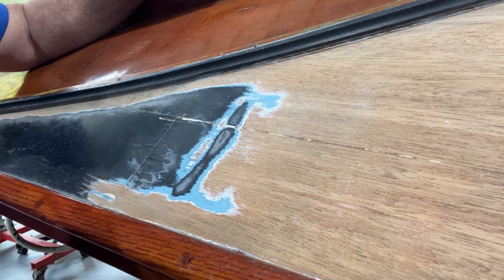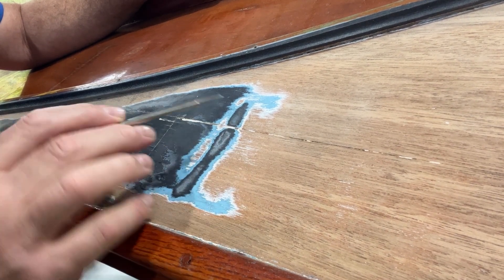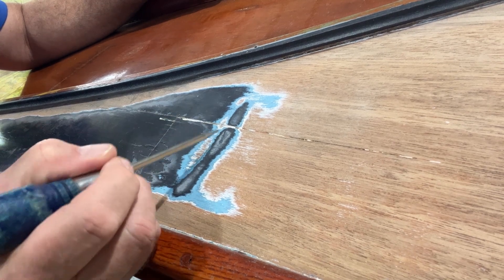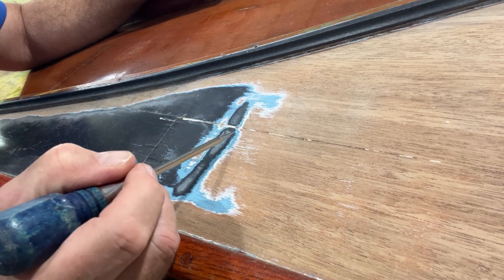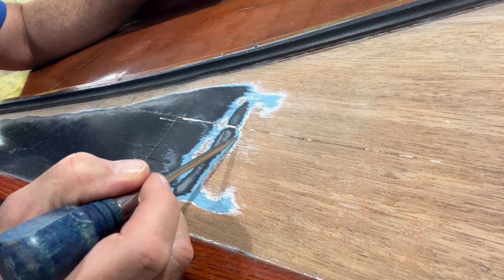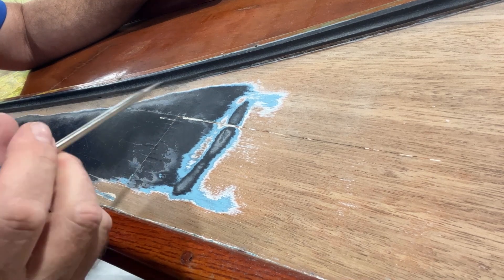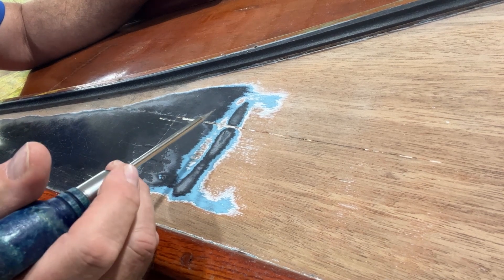I'm working on the starboard side of the boat where the color was black, but I was pretty sure it wasn't originally black. Here you can really see what's happened: you've got the black, then the gray primer — you use gray primer under a dark color — then a blue, and then white, which is used for brighter colors as a primer. So there's the blue, the gray primer, and the black, which was done in a later restoration — I'm thinking around 2012 from the registration stickers I already took off.